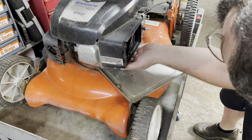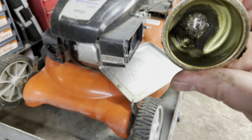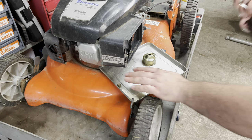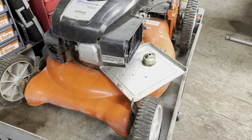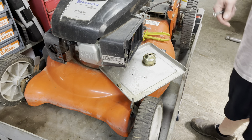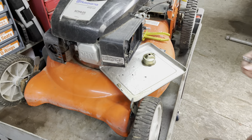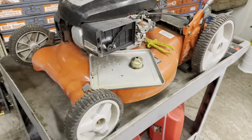There's some crud — it's jelly. I don't know how well you can see all that, but the bowl's not bad, it's going to clean up fine. I don't know when the last time he had this thing running was, but sometimes they'll run with jelly in them until they don't. Let me zoom in — see all the chunkage? And there's water in there, those droplets you can see. So the tank has got to be rinsed out, cleaned, and the carb's got to get gone through.